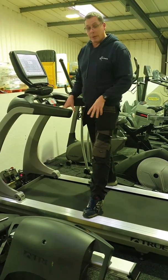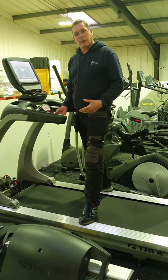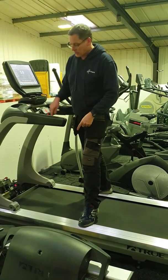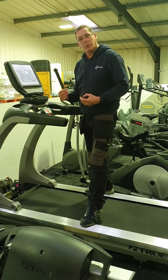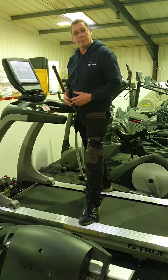So this is a good example. I'd like you to try that on your machine. You don't need to shoot a movie, just try it and tell me what you find. If it does slip, what I'm interested in is what's slipping — is it the running belt? Is the motor still turning? Is the drive belt slipping? See if you can identify where the problem is, if there's a problem, and then let me know. That's it. Thank you very much.